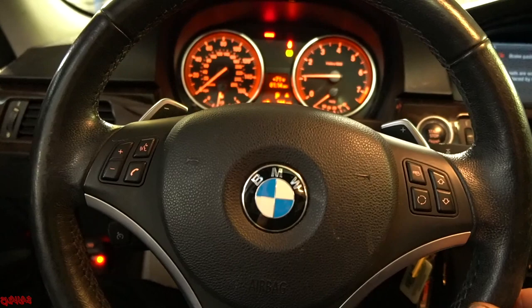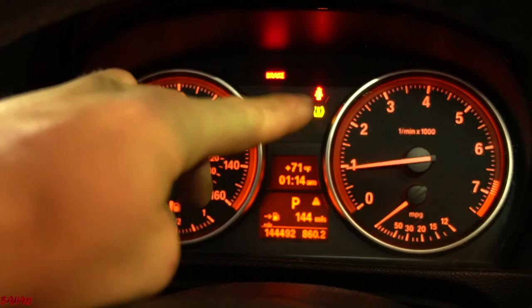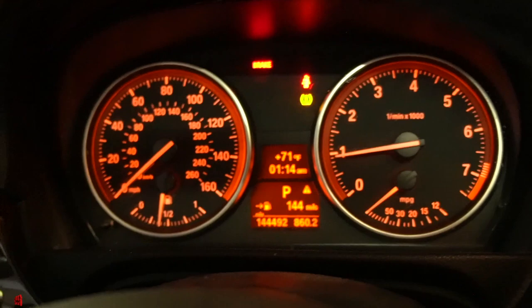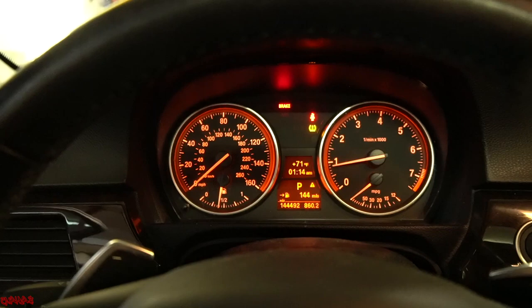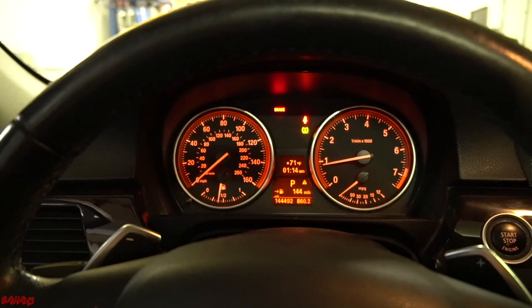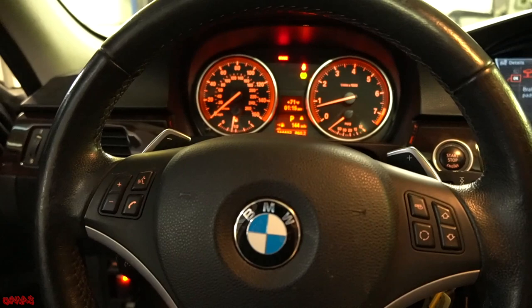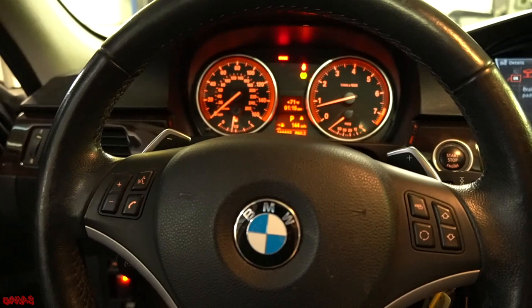Getting back in the car and starting it — no ABS light, no four-wheel-drive light, no DSC light, traction control is gone. We still have a TPMS light because there are no TPMS sensors in the tires, a brake light from the broken brake pad wear sensor, and the seatbelt light since I'm not buckled. That confirms the fix worked. This is how to diagnose, repair, and replace a transfer case actuator on an E90 328xi — also applicable to 330xi, 335xi, and similar E90-chassis BMWs with this type of transfer case. Thanks for watching Bathhouse TV — like, comment, subscribe!